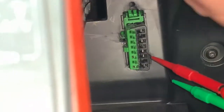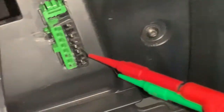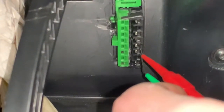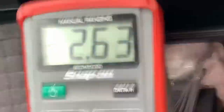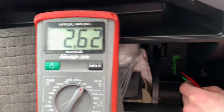So what we'll do now is switch it over to CAN high — I should really have a breakout box for this but I just haven't got one. We've got it switched over to CAN high and as we can see on the multimeter we've got 2.6, which is about right — 2.6 volts on CAN high.